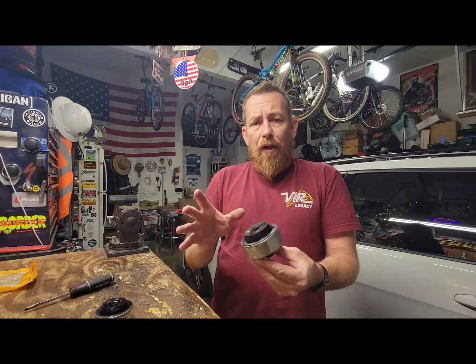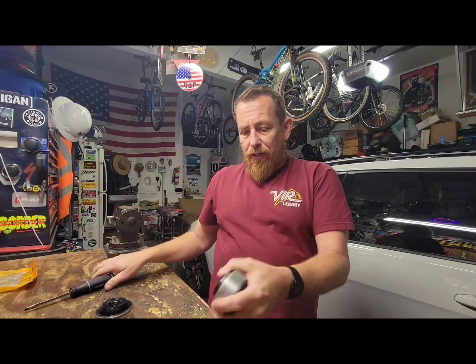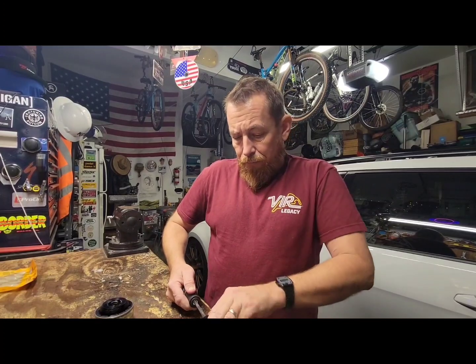But I wanted to talk about how these work because it's kind of interesting. A lot of people think polyurethane bushings are too hard, and in this position where they flex, they tear, and that rubber is better. Look, the polyurethane's fine. It looks brand new. What I want to show you is how this works. Imagine looking at this from the front. The arm is coming down here to the wheel, and it's moving up and down. There's a ball joint in here. These top little pieces are dust covers. So we'll just take this metal ring off, and take these off like this.